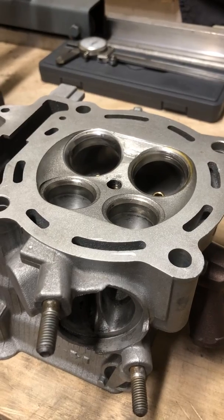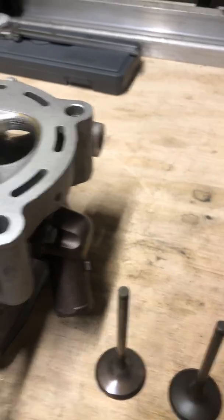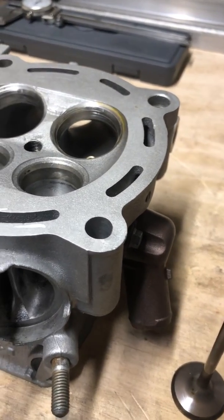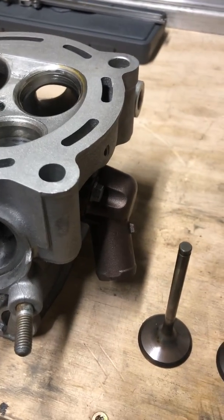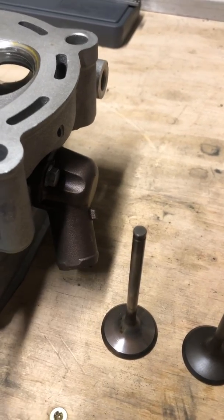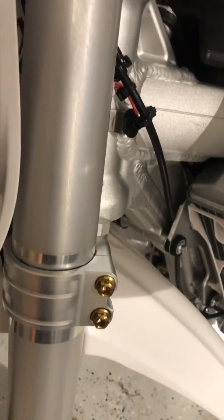That is the most common engine failure of 450 Kawasaki engines — intake valves snap. Why do the intake valves snap? They're titanium. Big misconception on titanium: everybody thinks titanium is the strongest material on earth. Not true. The strongest bolt you can get in titanium is only grade five. I have them all over my bike and I only put them in places where the torque specs weren't ridiculous, like your forks at 14 pounds of torque.